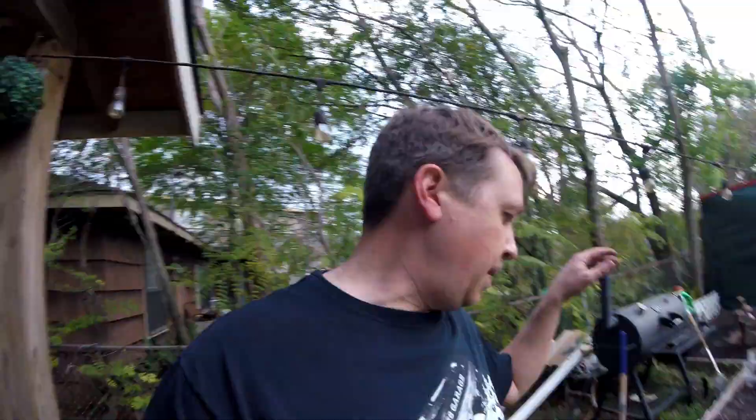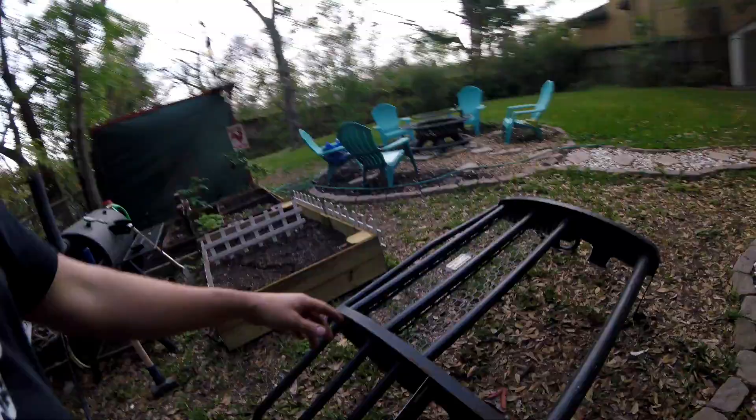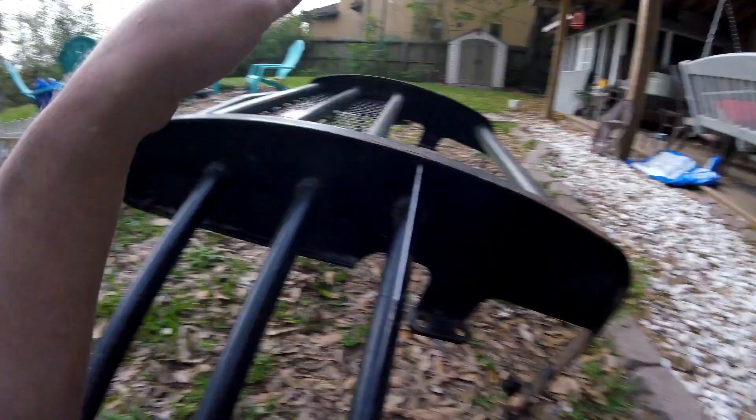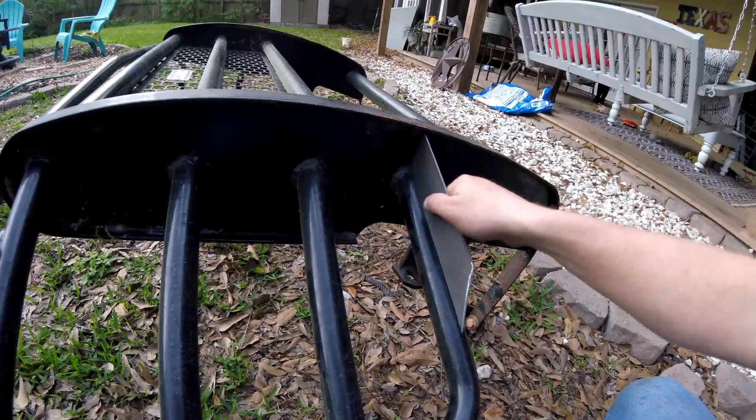This portion gets really tight up against the bumper so you can't really set it behind it, so we're going to set it in front — it doesn't really matter where they're placed. We got the bracket test fitted. We're going to jump over and make a second bracket for the other side because they're identical. Then we're going to grind all this black powder coat off anyway for new paint, so we can actually weld this piece to it to make a solid connection.